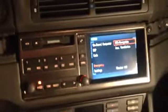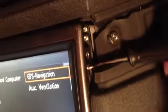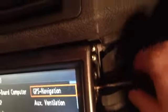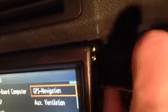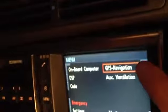With those two small screws out of the way, you're going to want to take a small screwdriver, and on each side, I'll try to do this side as the lighting is probably better. Let's focus on that real quick. Right here, I'm looking through the camera, so this is hard to see. You can fit your screwdriver in this little thing. If you pry it up, you'll feel that that's bending my screwdriver, and it's also spring-loaded. What you want to do is pry both sides up, and then this trim will pull away from the monitor. Maybe it can be done with one hand. If you notice, that's coming away from the display. So now we'll come on this side. Obviously don't pull out too far, you'll pinch it in there.